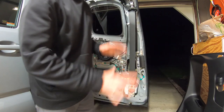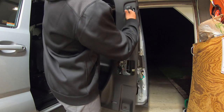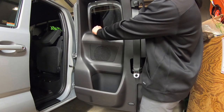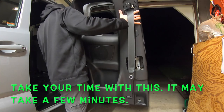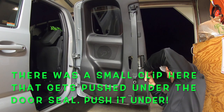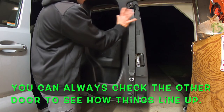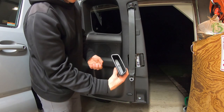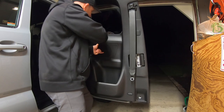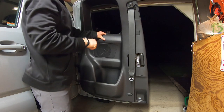Now we have to reverse our steps and put the panel back on. Feed your seat belt through the housing — that's important, make sure you get the actual buckle itself too. Little tip: take out the cup that's in your door handle; it'll make reinstalling the panel much easier. That took a couple minutes to get back on — it's kind of tricky since there are about ten different plugs that have to go into their correct holes on the back side which you can't see.